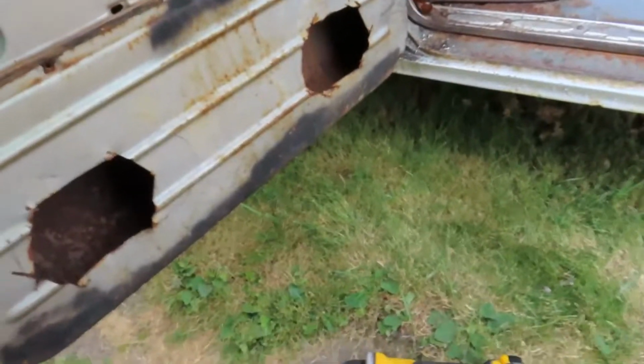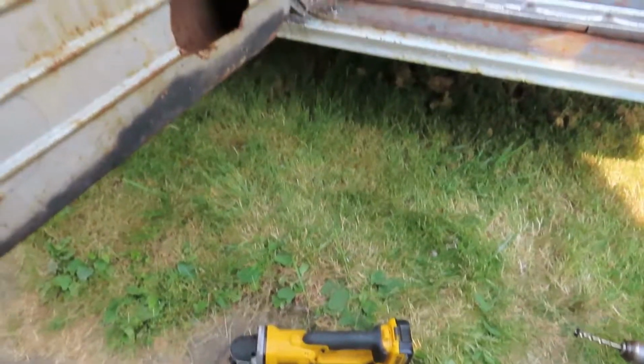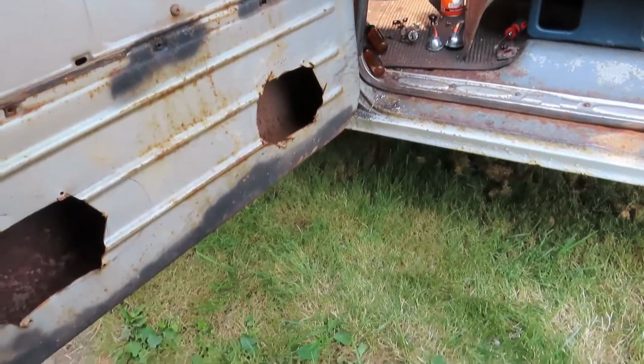Whew. We have reached a measure of success. So, I heated that bottom bolt cherry red. I mean, I heard metal popping and expanding inside the truck. I got it hot. I don't like doing that because there shouldn't be anything back there, but you just don't know. But I got it hot. And then I took my big screwdriver and I backed the screw out. Perfect. Then I got the grinder out and I started grinding that upper boogered weld.